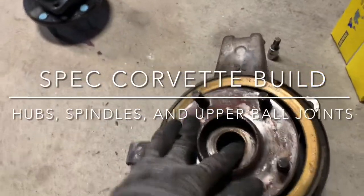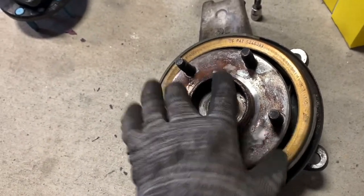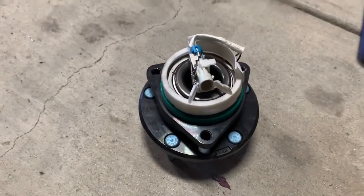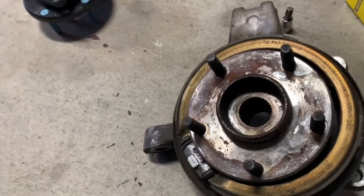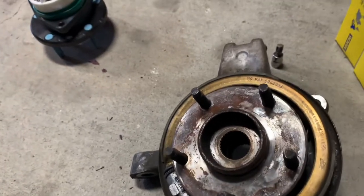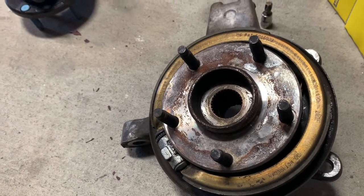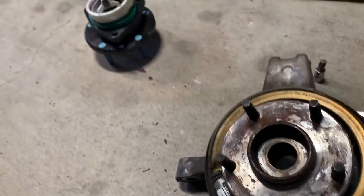I'm going to work on my steering knuckles. First thing I'll be doing is removing this stock hub and upgrading it to an SKF hub. The reason for that is that these stock hubs are known to fail — they're pretty atrocious when it comes to track duty, so this is something you're definitely going to want to do early on. As they start to fail, you'll notice things like uneven brake pad wear, and it could even get downright dangerous, so you're better off replacing these things early on.